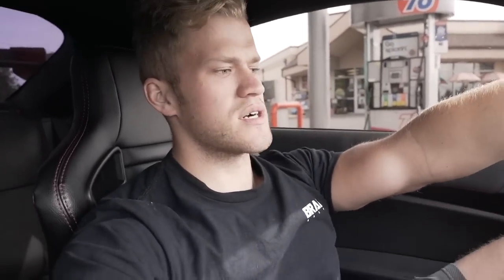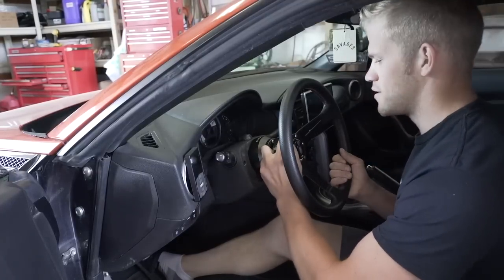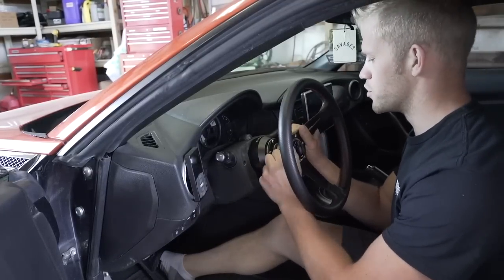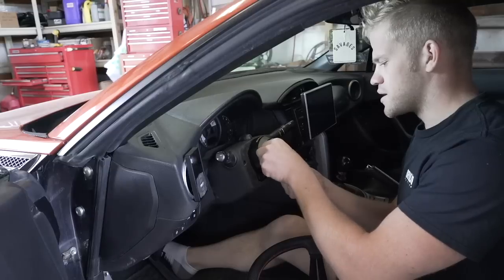I'm not sure how close this sits to me. I'm thinking I'll go home, pull off the quick release assembly, and bolt the steering wheel right to the short hub to see if that makes it about two inches closer. I really like how it looks and feels — it's just that there are so many things you lose when you put an aftermarket steering wheel on: horn, airbag, cruise control, and it sits super close. Let me know in the comments if you've dealt with this and whether you'd continue to run it.